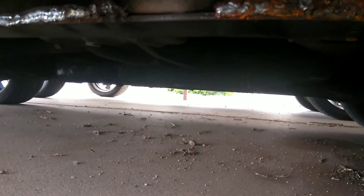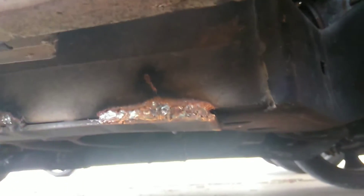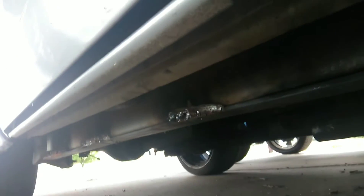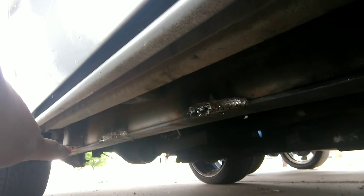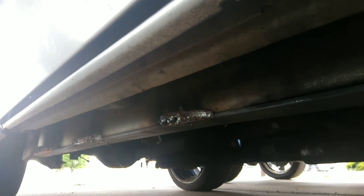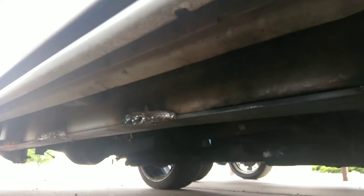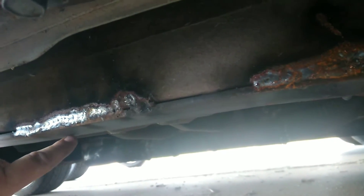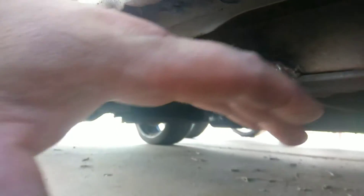When we tried to use the floor to bend this chassis and frame back, we wrapped a chain around here. Now, this is a box car frame — we never thought that it would bend or sag, but it did. We wrapped a chain around right back there, then jacked up right here. No matter how much we jacked, it would always just spring right back. So what this old-timer told me to do is just go ahead and run a bead right in the middle of this frame all the way down, and that will pull that metal to where it will suck that frame back up.